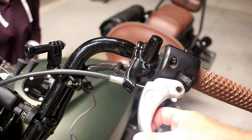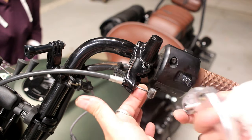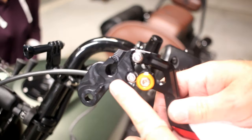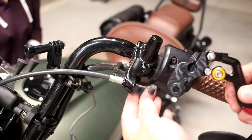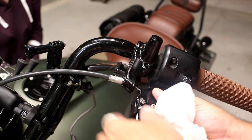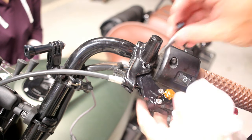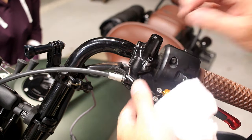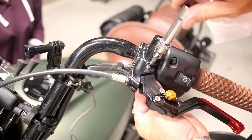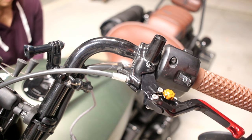I got the slack off the clutch cable, which allows me to pull this out a little bit. If you've ever worked on a bicycle, it's the same concept — just like a brake cable on a bicycle. You put that in there, slide it, rotate it, and put it back in place. We have the same circle with a cutout here, so we put that in, get the cable in the cutout, and now it's actually on for all intents and purposes.